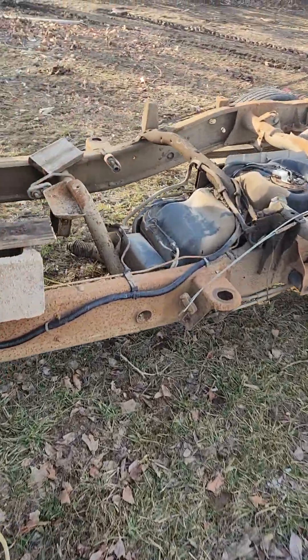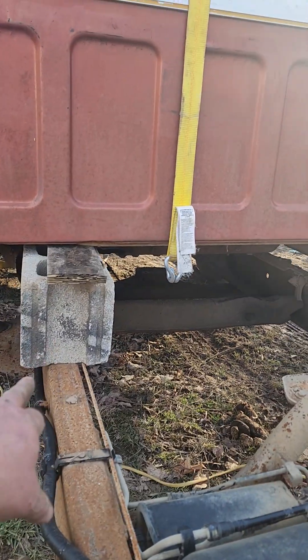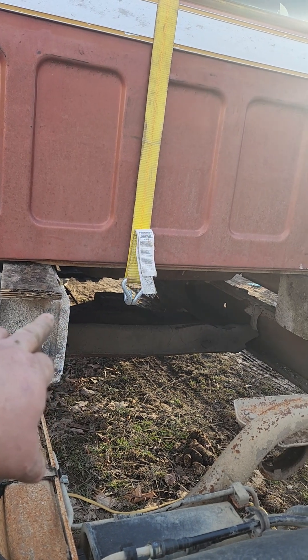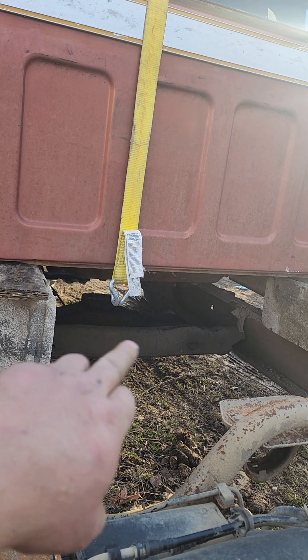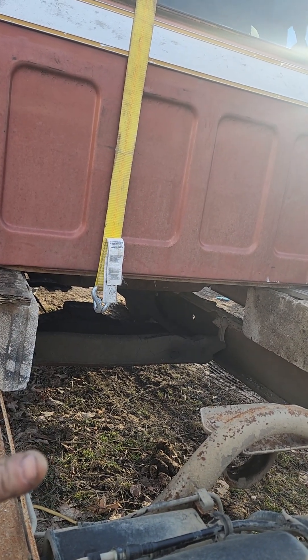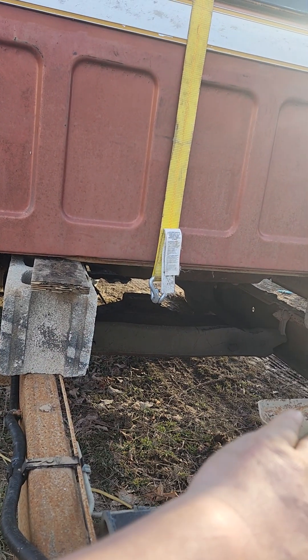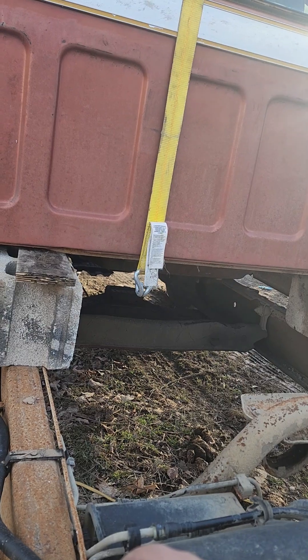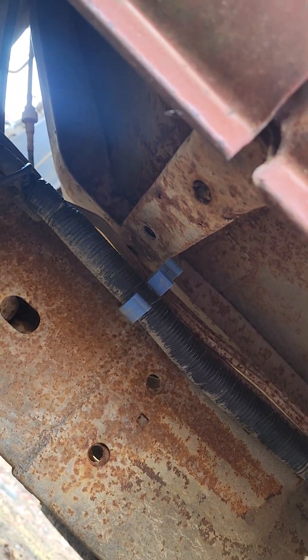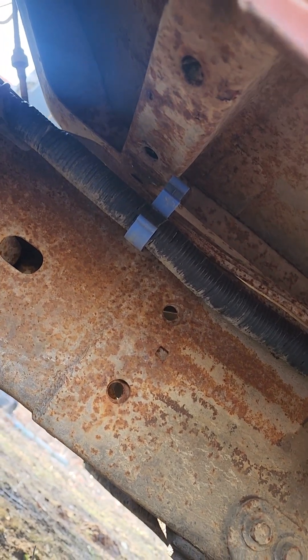I may use some of his ideas for the mounts. I'm probably going to have some tubing bent and have it come up to meet the rear cab mount - that'll be the simplest way. I'll do two pieces of tubing that arch up, about 100-degree bends, not quite square, coming off the frame and up over and back down in the same arc. The front cab mounts on the square body go directly to the center of that frame, so I'll have to figure out something else there.